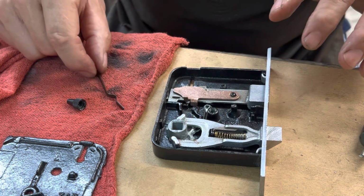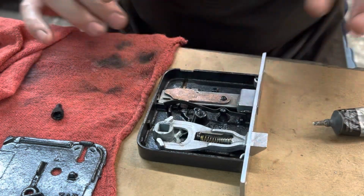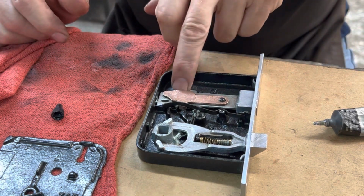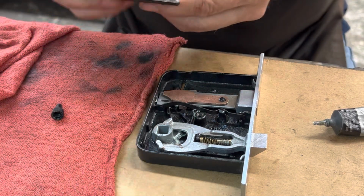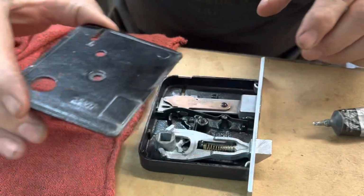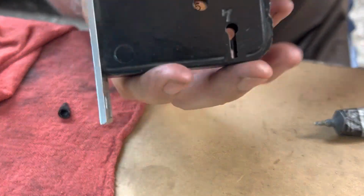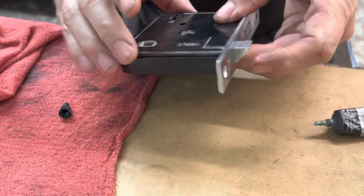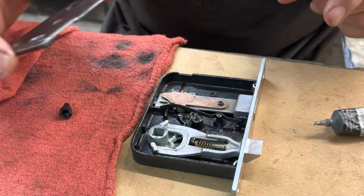Goes like that. Hopefully I'll remember how this goes here. Okay, cool. All right, this is how your lock goes into place, the door handle I should say, and then there's a skeleton key that goes here, and that's what works this mechanism right there. This is your cover. You just put it right back into place, and you can see the number 5 through that window now, whereas it wasn't really visible before. It had that heavy patina coating on it. But yeah, looks really good.